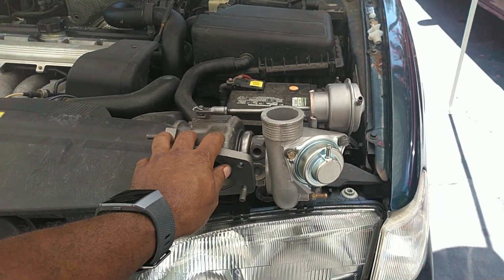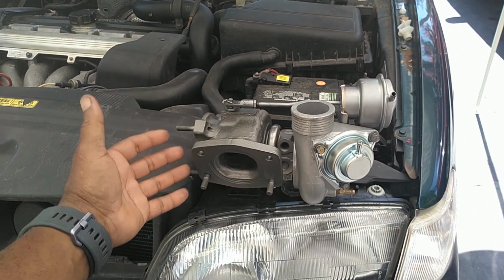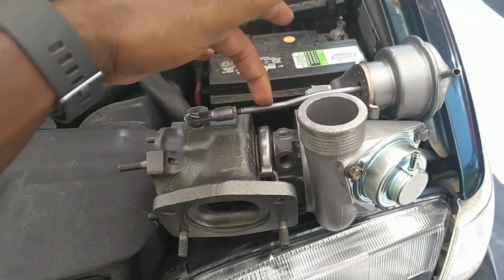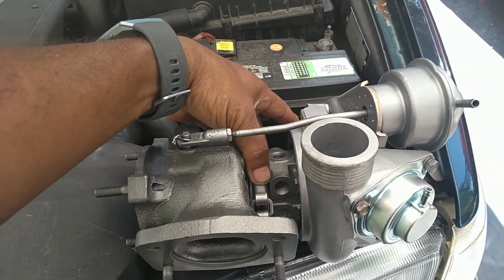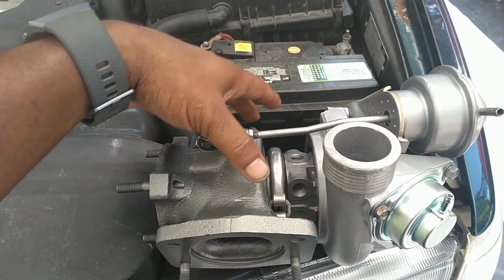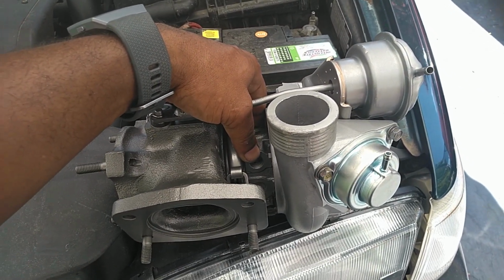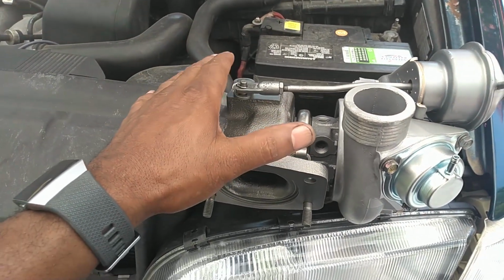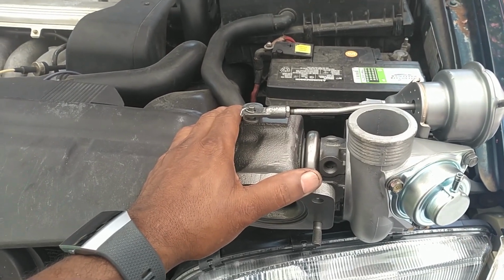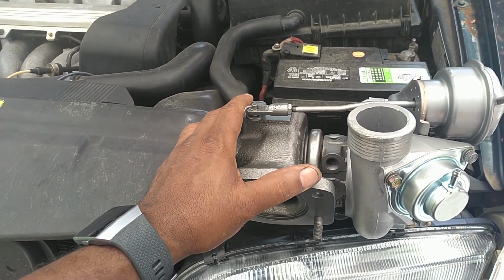Some turbos don't have the exhaust flange that you can unbolt from the exhaust manifold, and it is part of the exhaust manifold, which makes it more complicated to service. Now, if they have this clamp here, you can take it apart and separate the exhaust manifold or exhaust flange from the CHRA of the turbo, which some people do. That's what I normally do, because I normally don't service my exhaust flange. Very rarely wear out. If they're aftermarket or cheap, they'll wear out. If they're OEM good quality ones, they may last a very long time.